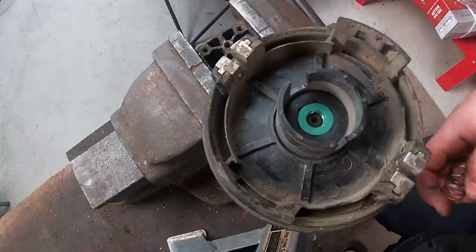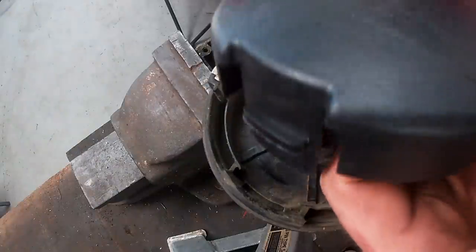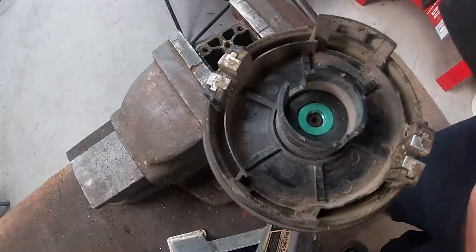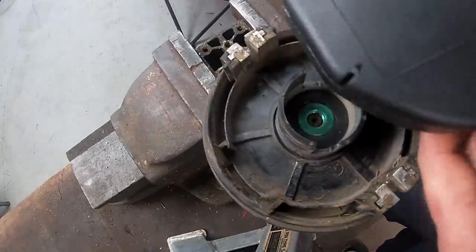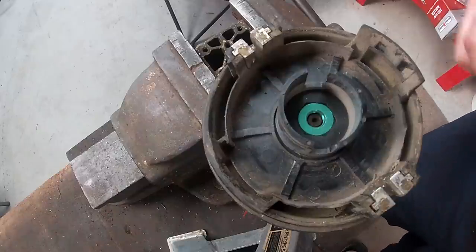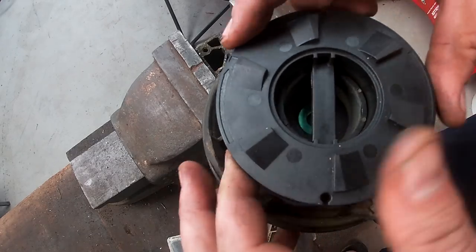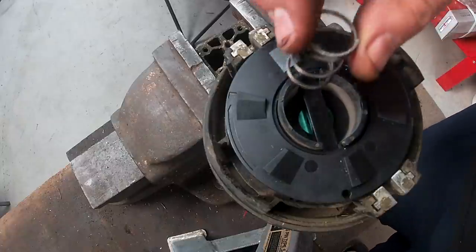So it's going to replace the missing components. It's a matter of just taking a new spindle. Now these are cheap. In my Blademate lawn care videos, I often have some people telling me that I shouldn't be tapping this on concrete because it wears these out too quick. Now the reason you tap it, that's just to press down on the little spring here and continue to feed the cord out. And obviously if you tap it on a hard surface, this will wear out quicker as well. Gets all holes and just, yeah, plastic getting worn through because it spins real quick. The reason I tap it on the concrete is just because sometimes if you hit it on the grass and it sends it out real quick, real suddenly, you can just leave a little patch, like a chunk out of the grass, which I don't really like doing. So I'm happy to replace these periodically, which you'd have to anyway, rather than, you know, take a chunk out of a lawn. So just cost of doing business, I guess.